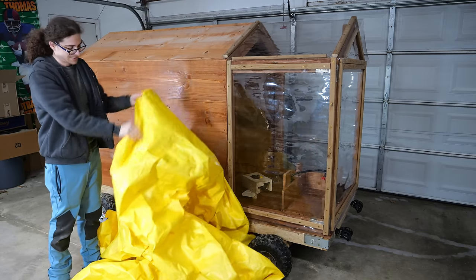But before I stick it in there permanently, I want to take some clear silicone and go around the perimeter of the window with a nice thick bead. Then I can take the window and plop it in the hole. I take some more of the silicone and fill up all the other gaps around the window and make another little bead all around the exterior as well. I take the other half of the window, line it up with the registration point, and push it in place. Using the holes in the side as a guide, I drilled and put in some machine screws and bolts and tightened it all down through the wood. One down, one more to go. I headed on to the other side and popped a hole through that wall, then installed that window just the same with a bunch of silicone and machine screws and nuts. And now we have some really cool looking windows on this thing — I love how you can actually open and close them, they're made of glass, they have a nice gasket, and they just make me smile.